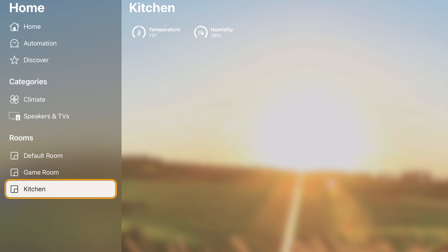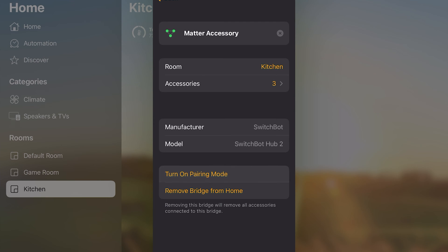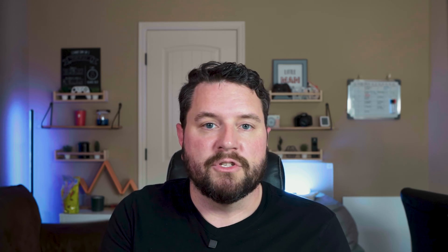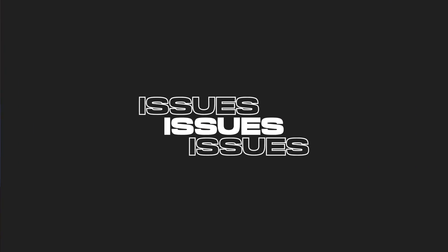Using Apple Home as an example: open up your Apple Home app and click on any of the devices. From here you can click Bridges. From there, you can put the bridge in pairing mode — this will generate a unique pairing code, but it will not generate a QR code for some reason. This pairing code will only last a few minutes and allows you to connect to a secondary bridge. Go ahead and open up your secondary bridge of choice — in my case, Google Home. Go through the standard process of pairing in that one just like we did in the previous step, and those devices should transfer through. I've been having some problems with my Google Home, so I also paired it to Home Assistant to test and it worked fine. I have a feeling this is an issue between SwitchBot and Google Home.